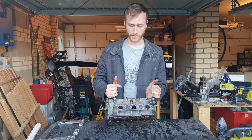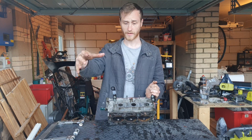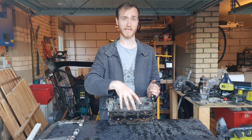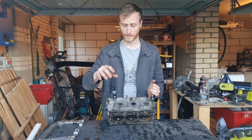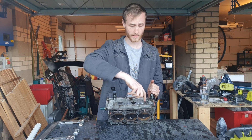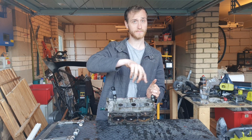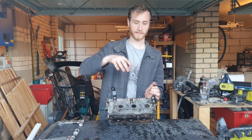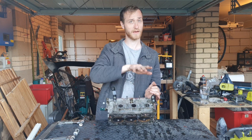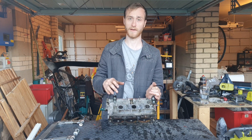You have two sets of ports. You have the three intake ports — this is where the air comes in through the air box, through the intake manifold. If you've got a turbo, it'll come through a turbo beforehand as well, and then it'll go into here. Just inside each port is the back end of the valve head, and the air will rush past that when the valve opens and into the combustion chamber, then be stopped when that valve comes back up.